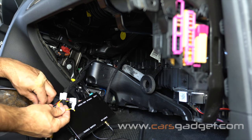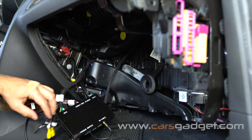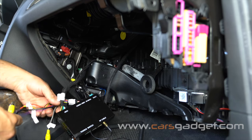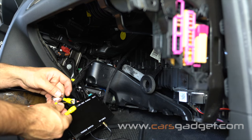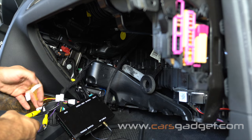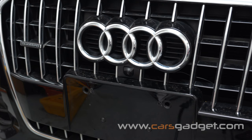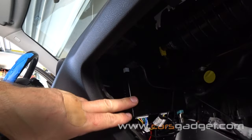At the AV cable you'll find a red and a yellow wire. The yellow wire is a power wire for the rear view camera and the red wire is for the front view camera, along with RCA connectors for the front and rear view cameras. If your car already has an OEM backup camera you can stop here and assemble everything. In this video we're installing a rear view camera: connect the rear view camera RCA into the yellow RCA input at the interface unit, and connect the red wire from the RCA with the yellow wire labeled '12V reverse camera out.' For the front view camera, watch the other video on YouTube.